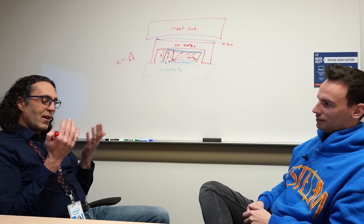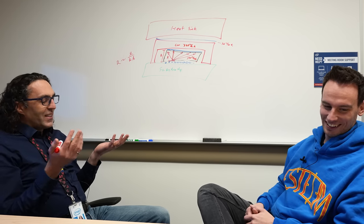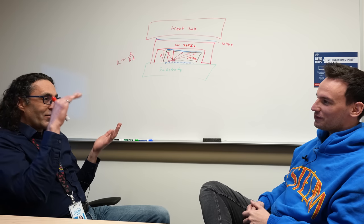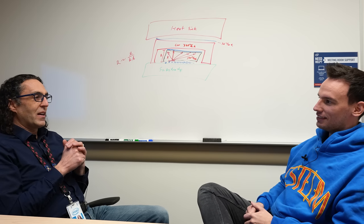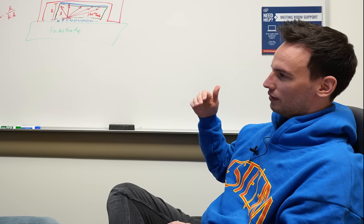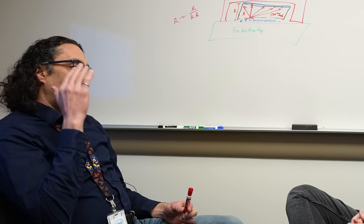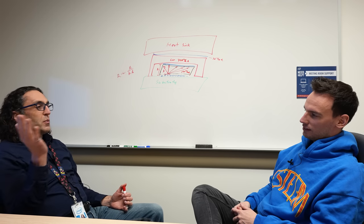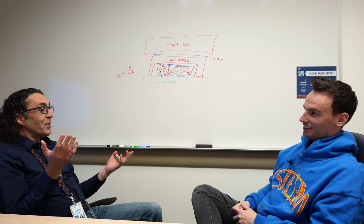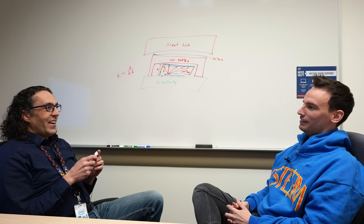When I read comments online, everybody starts freaking out if they see a CPU above 90 degrees C. But really — go look at our specs. 100 degrees C is usually right around where our actual spec is, and we've got safeguards in place that prevent the part from going above it. So technically that would mean if you run your CPU for three years at exactly that temperature, that's the spec. If you had your CPU looping Cinebench for three years, I honestly don't know what would happen. You would have a very good energy bill.